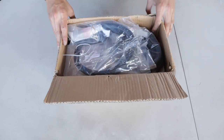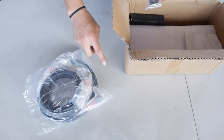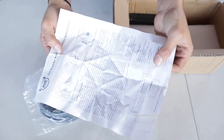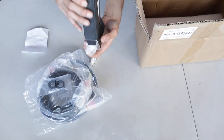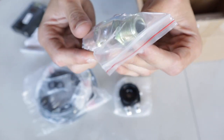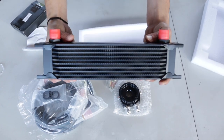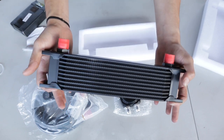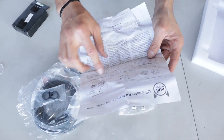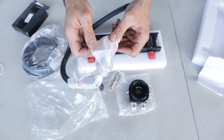Inside this box I got some nice stainless steel braided hoses — got two of them, one for the return and one for the feed, and here is a fitting to keep the two hoses together in the line. We get instructions in the box because we get a sandwich plate, a fitting for the oil filter, and last but not least, the actual cooler. This is a 10 row. I bought this kit online and I will put the link in the description. The instructions show how to install the sandwich plate, which is pretty straightforward. In this kit are included some nice braided black hoses with black and red AN fittings.